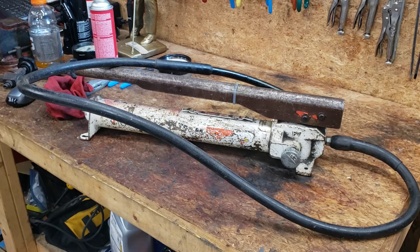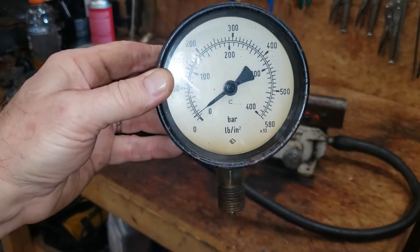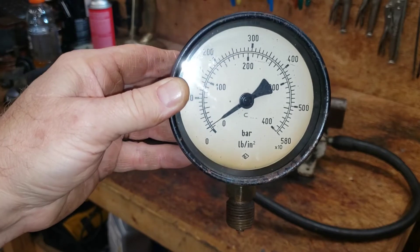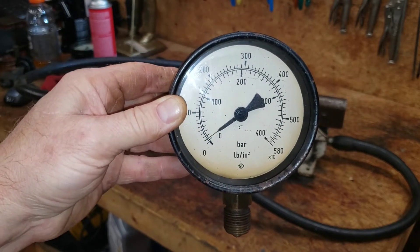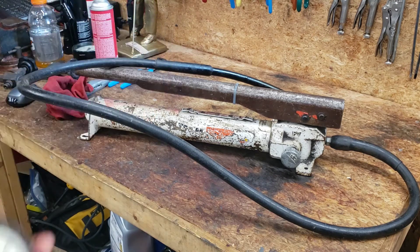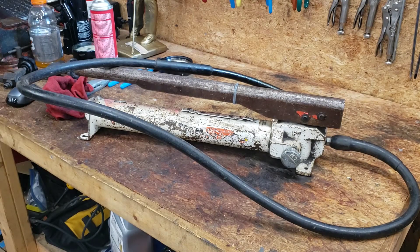That's it for now — just a quick vlog on my plans to build a pop pressure tester to balance the fuel injectors on our old 300SD. We've got an old hydraulic pump in hand and a diesel injector pressure gauge. One more thing: this gauge does go to 5,800 PSI — yes, I know that far exceeds the roughly 2,000 PSI range you'd typically want for an older OM617 engine, but I think I can make it work. I kind of like these old gauges — they're huge, as big as my hand. Don't forget to like, share, and subscribe, and click the bell to be notified. We're going to be balancing the injectors on this old Mercedes soon — take it easy.